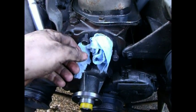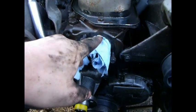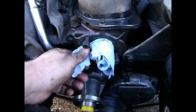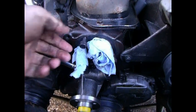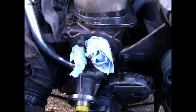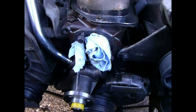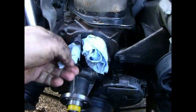Here's a very good tip. When you're doing a job where you're leaving orifices and places that stuff can get into the engine open overnight or even up to a few days, at the least it's a good measure to stick rags in — not very far, just enough to seal things out. Also, put your screws and bolts back to where you got them from. That way whenever you go to look for them again they'll be right there — you won't be looking all over the engine bay, and you don't have to worry about lost or mixed-up screws.